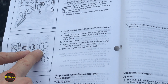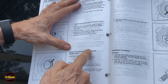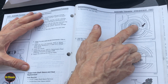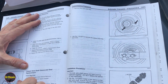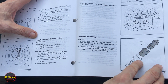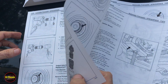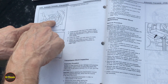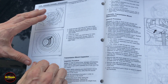The main reason I'm showing the older manual is that instead of using the slide hammer to remove the seal like in the later manual, the older one recommends just using a deform method by hitting the side of it with a screwdriver. Then same puller to get the sleeve off, and the same collet and shaft assembly to put the new sleeve on. The only real difference in the old manual is how you remove the seal. The J41102-1 is just a plastic version of the aluminum tool I'm going to use — the plastic didn't hold up, so they went to aluminum instead.